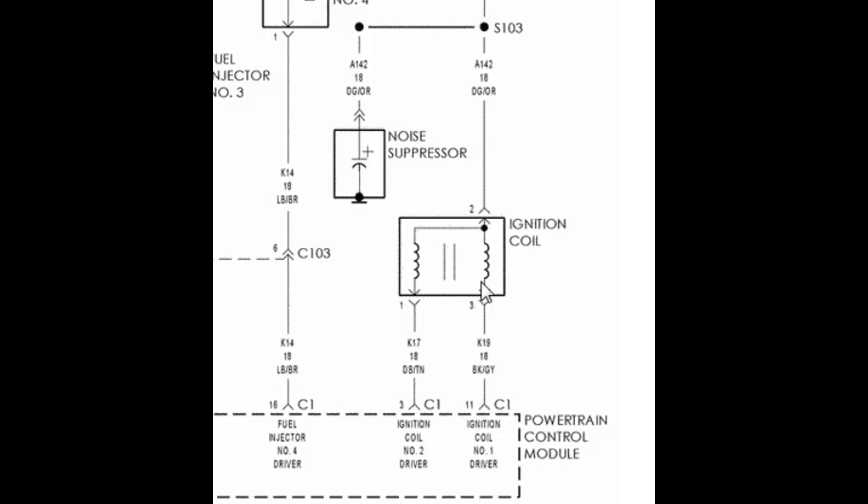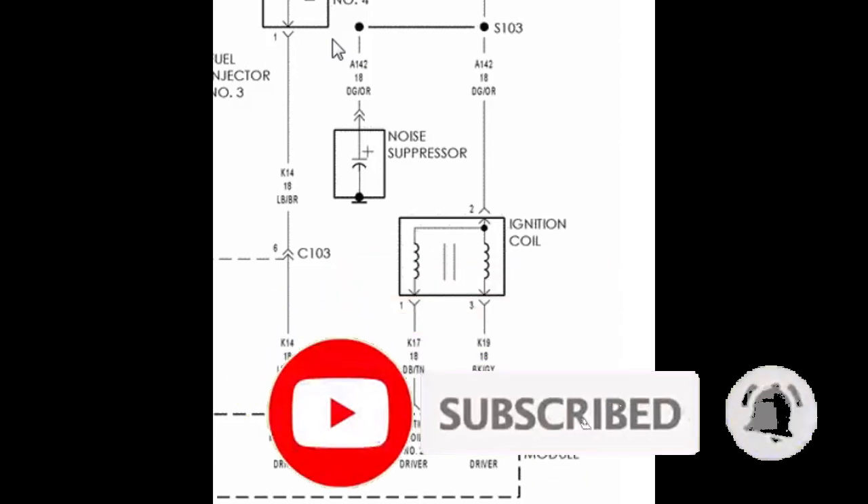On the flip side, if you are getting your duty cycle ground at the coil connector and you do have ASD power there, then your PCM is fine and you simply have a shorted-out coil. I hope that helps — I wanted to make a video rather than type it all out. Whether it ends up being the coil or the PCM, at least you have peace of mind knowing you replaced the right part. Thanks for the question and for watching. Comment and subscribe if you have questions, give the video a thumbs up, and share it if you know anyone with a PT Cruiser having this same issue. The same test method applies to a no-start with no spark condition.